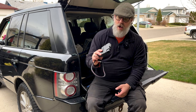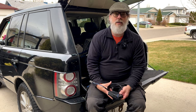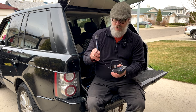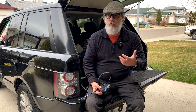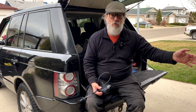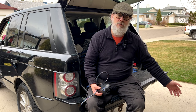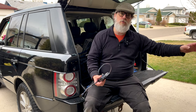What these are is a system which communicates braking potential to the towed vehicle, and they do that through electrical means. Basically this unit plugs up into the dashboard and it interprets or communicates the braking force on the pedal to the towed vehicle. There's a connection in the wiring harness where you plug your trailer into the back of the car.